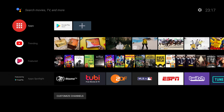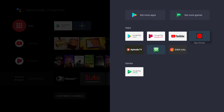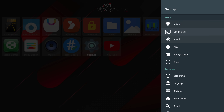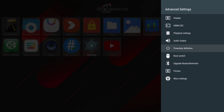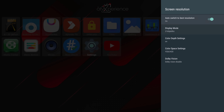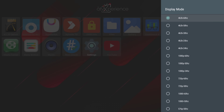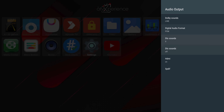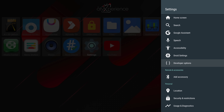To get all the special system settings from the old firmware, open the apps section. There is an app drawer here, similar to the sideload launcher application, where you will see all sideloaded apps along with all other installed apps. There is also a system setting section where you will find all the features of the old firmware — including the root switch, 4K resolution up to 2160p settings, Dolby Vision, digital surround sound audio settings, and access to developer options.